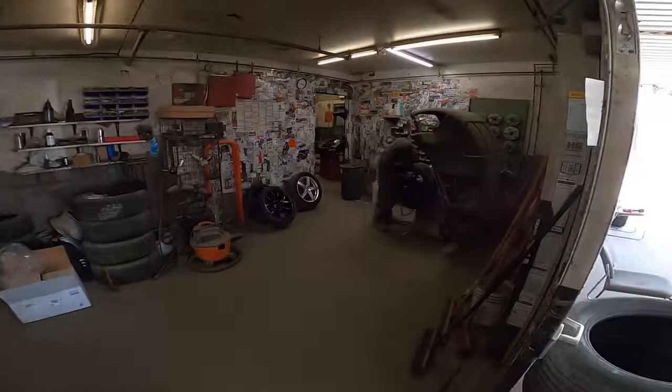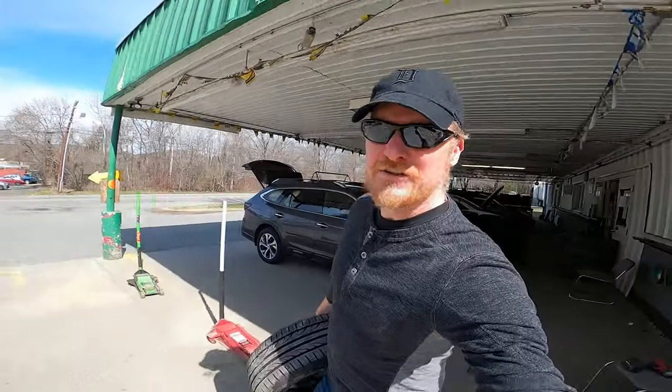They said the wheels are spinning out great — so much easier than Harbor Freight spoons. Wheel number three had a high spot, so they rotated the tire to better align it with the rim. The rim itself spins out perfect, so it must just be tire manufacturing imperfections. These guys know their stuff — they know road force balancing. This is the first shop I've been to that will actually unmount the tire, turn it, remount it, and rebalance it. Most tire shops just spin it and send you on your way. I appreciate their efforts tremendously.